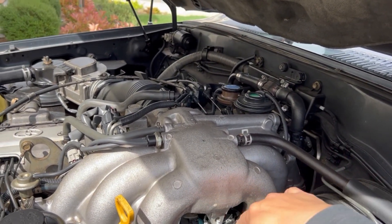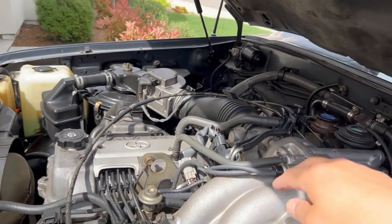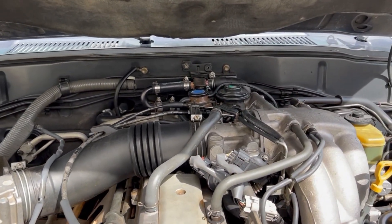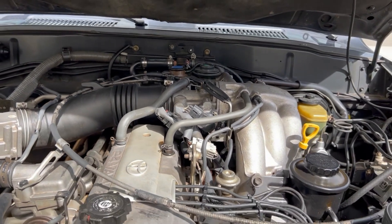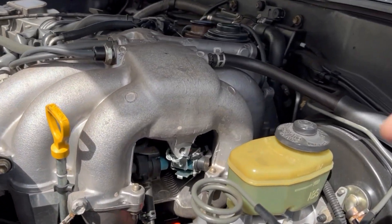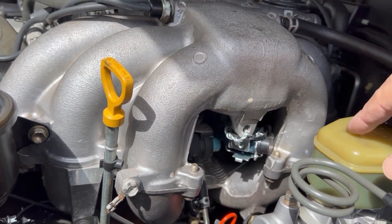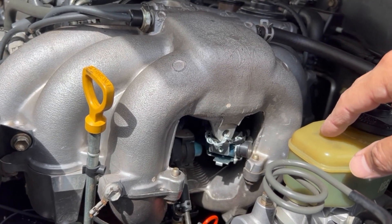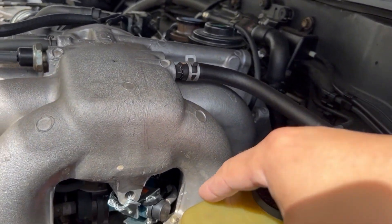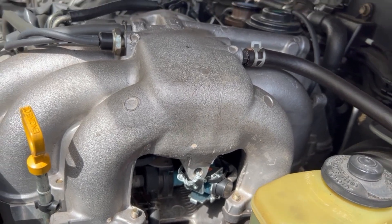I used a wire cable to mount it here so that if I ever need to replace it again it won't be too difficult — I just unplug it and remove two hoses, one here and one in the back. With that change it fixed my check engine light. Every other fix — the brand new Toyota OEM EGR valve, the modulator, the O2 sensor — did not fix the problem. This VSV was the culprit. I've been driving it for about 100 miles with no check engine light, went on the freeway at 2800 RPM, no problem. It's all mounted here, secured, with very little wiggle room, and I can access it when I need to.